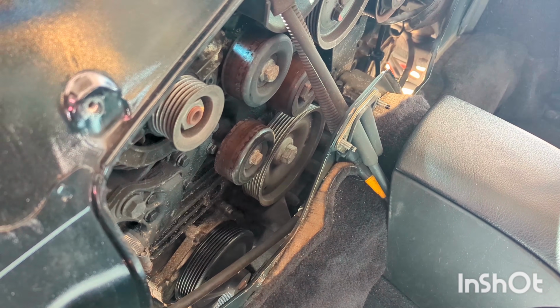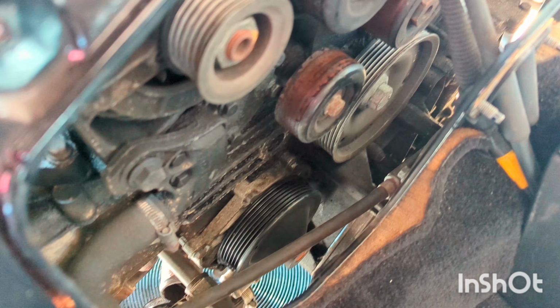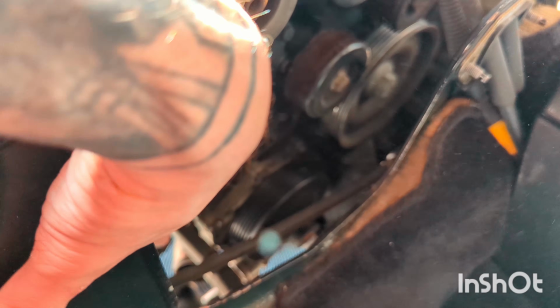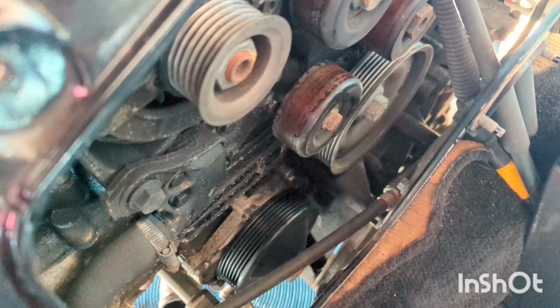Right, so we have removed the belt. We've already changed the sender down there. We're just waiting for the rest of the coolant to drip out, and then we'll go ahead and we'll remove the bolts around the pump and the thermostat down there and get them swapped out. Again, if you want a full DIY, there is a video on the channel. It'll be in the description below.